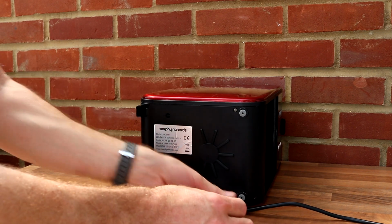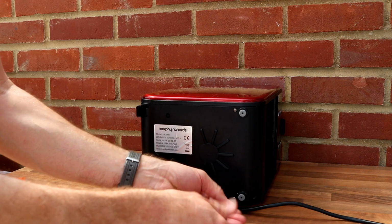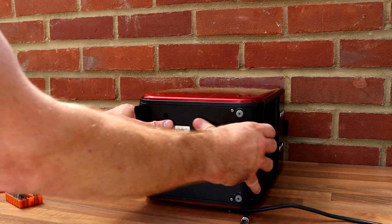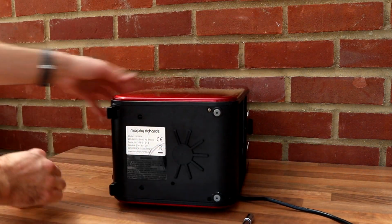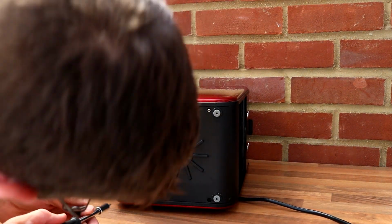It still worked from an electrical point of view because the display came on and I could hear clicking of the relays, etc. So that bit worked, but no heating, and if you haven't got any heating at all, the water doesn't flow and it's a waste of time.